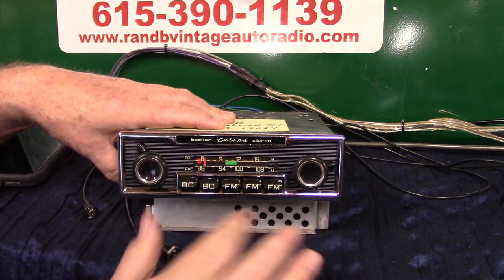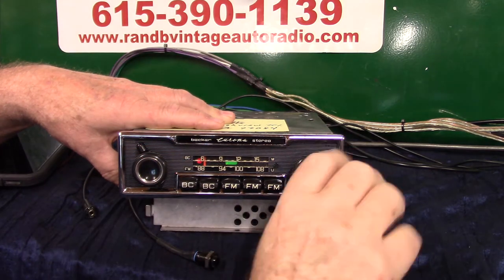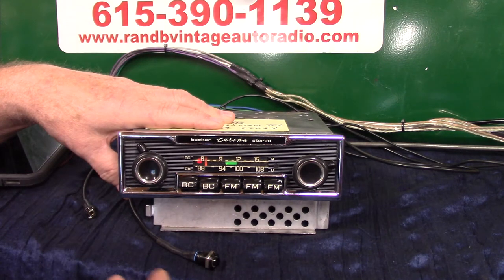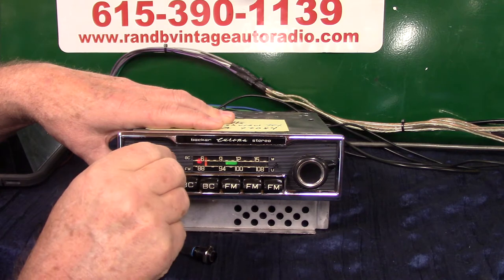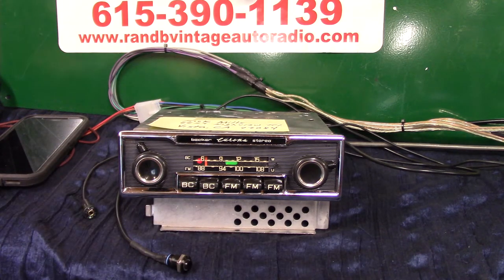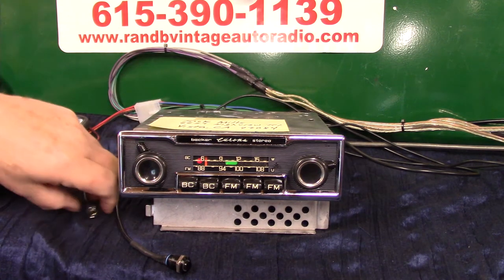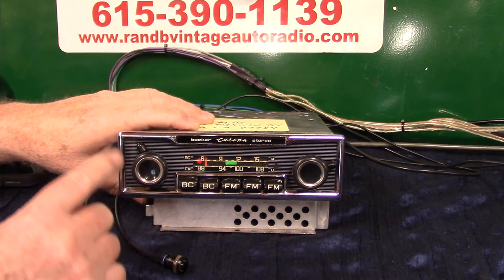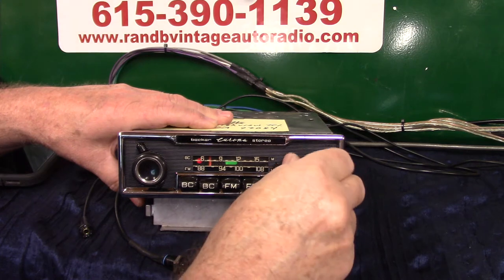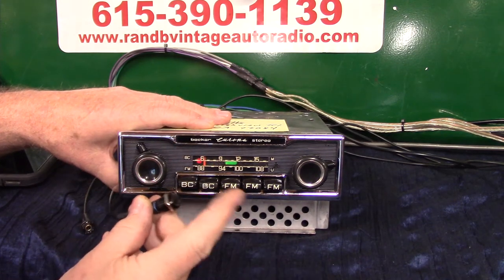The little button also works with everything else. You can push it four quick times and put it in scanning mode and let it find a station for you, or you can turn it up twice. It'll go from station to station without the needle moving. To lock on a station and find it on the dial in case you want to preset it — say you like that station — all you do is turn it once. Station hold. She'll lock on it. As soon as she says that, start moving the dial until you come up on it. Pull out a preset and you got it. Or tap three quick times and it'll hold in.